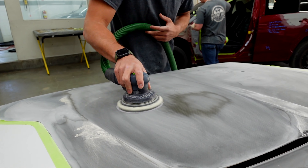Another very important thing when it comes to uniformity, especially with clear coat, is pulling the wet line. If I spray half of the hood and then start in the middle, by the time I get there the clear is going to be a little dry and it's not going to have a clean look. So I'm going to reach over the hood, grab that wet line, and pull it back this way. For the third and final coat, you don't want to just hammer coat after coat of clear because it's going to run on you. Let it flash off for about five minutes, then come in and touch it — if it feels a little tacky like super glue, you're ready to go and it won't run again.